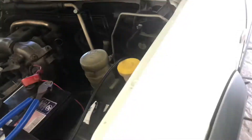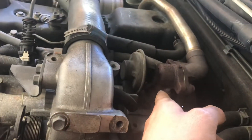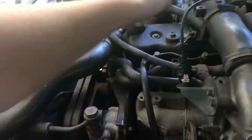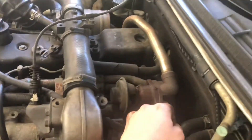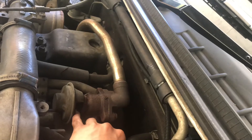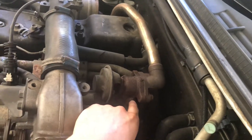On my car I found out that it has a reroute system and it's not even an EGR — I thought it was — but that there is actually like a blow-off valve of some sort. Basically all you're doing is running a vacuum line from the EGR solenoid all the way back to this. When I rev it, this little thing goes in and then when you let off the throttle it comes back out, indicating that it's shut off this valve so that no gases can come back through the exhaust into the intake.